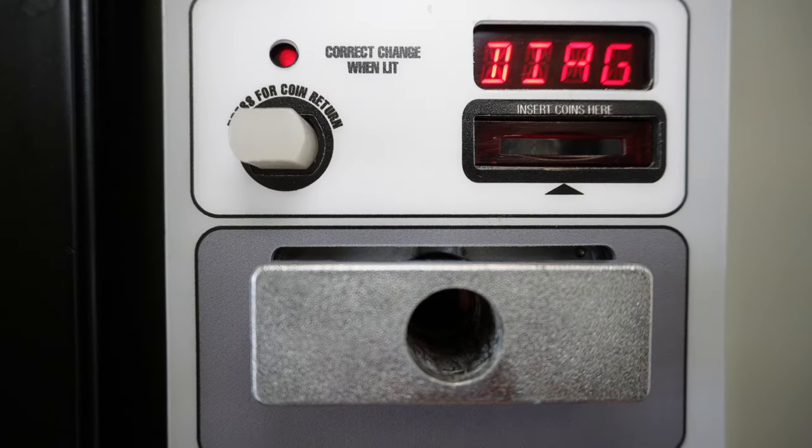We're going to move to our next option — press and hold selection buttons one and two together to go to SW, which is sold switch. This is telling us visually which circuits are not completed. It's going to show us sequentially from one through ten — even though it's a nine-select machine, there are some ten-select machines, and the control board can do ten.